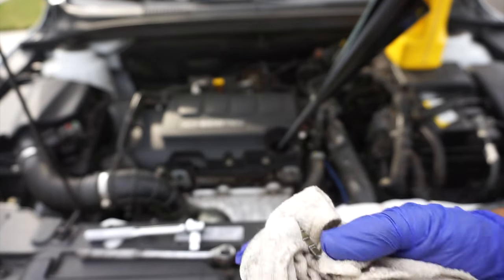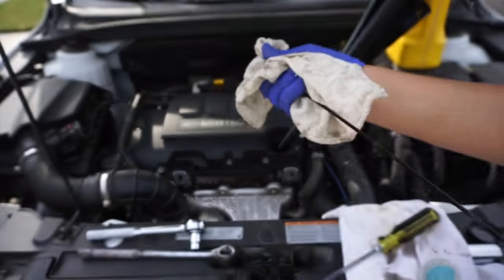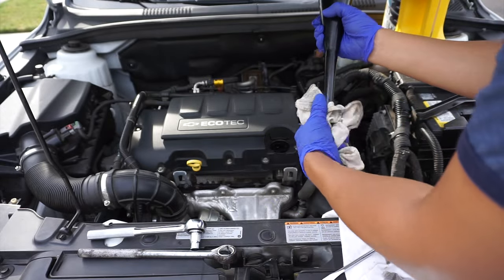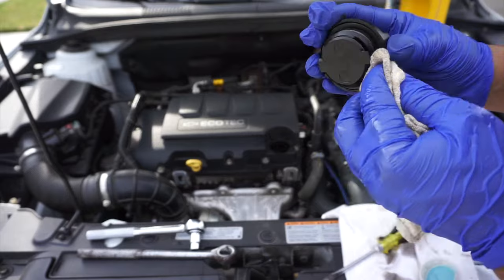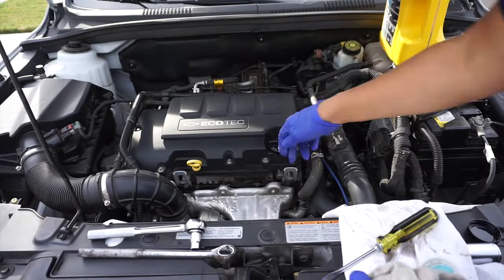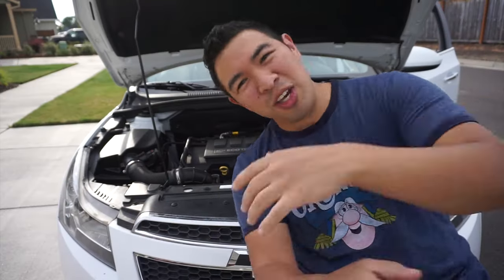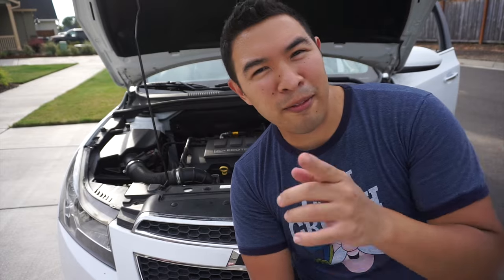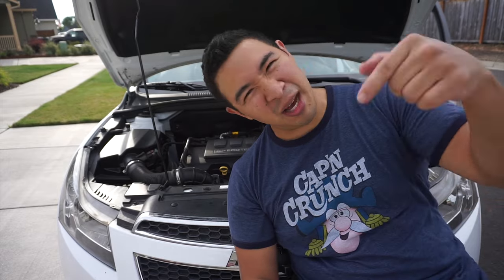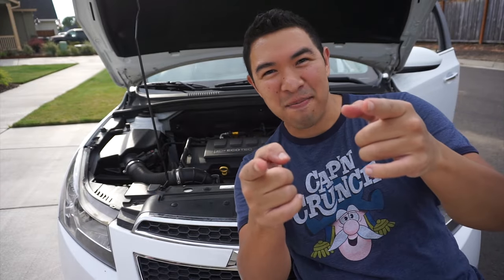And here we go — moment of truth. Right there where we want it to be. Our oil has been replaced. Before I put the oil cap on, I like to check if there's excess grime — occasionally you should change even this O-ring. A little bit of grime on this one. Put the cap back on and you, my friend, have just changed the oil in your car. Good work. Don't forget to check the oil level after your first drive and top it off as needed. Thanks for tuning in — let me know what you think in the comments below, don't forget to like if you liked the video, subscribe if you want to see more, and I'll see you guys next time on Drive-By Reviews.